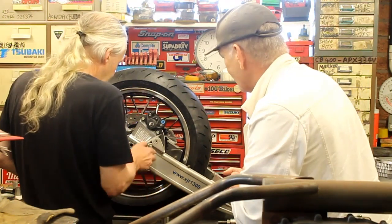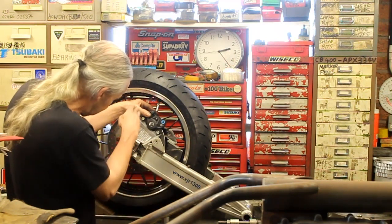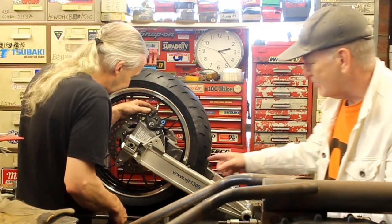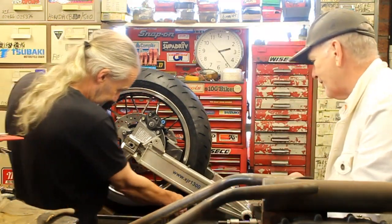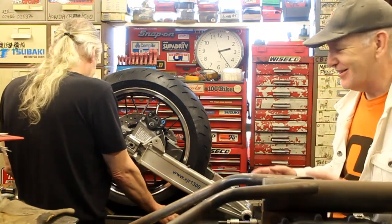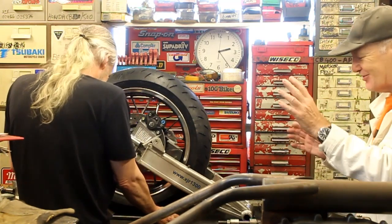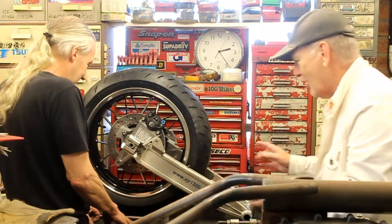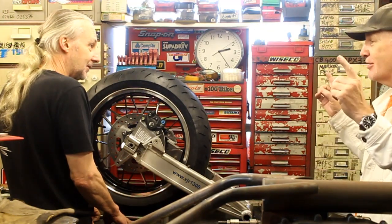Actually, I think I've got one. I've only rested that in there. Spin. So, like you say, it's worked. The angle of that, it was working. So the next thing to do is to make a torque arm from here to here. I gave them and then took them home again. They do a female rose joint, he wants a male rose joint, so I'll have to go and buy some more. It's no problem. I've also ordered for me a 1 meter length of 20 mil diameter alloy rod.